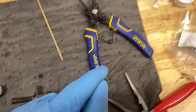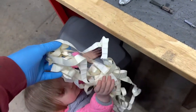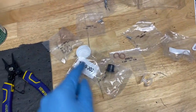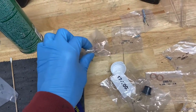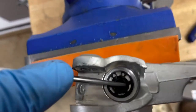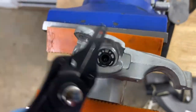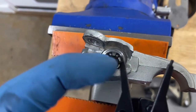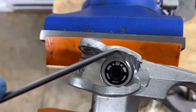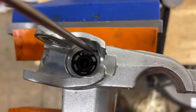So next we're going to put on the new snap ring. Some of these bikes did have a spring in it — my particular bike did not, so if your bike has it, put that in. Now, snap ring — we've got the snap ring in. You'll definitely want to put it in a vise and push that piston down while you try to get that snap ring in there. It can be a little difficult because the snap ring likes to slide all the way down. Get it down close, and if it's not wanting to go in, as long as you start one part of the snap ring, you can walk it and tap it around down. Make sure it's fully snapped in.